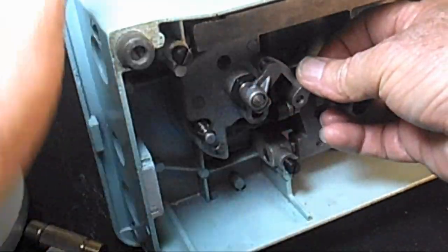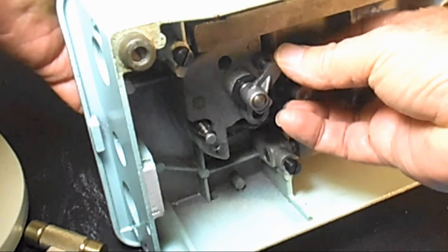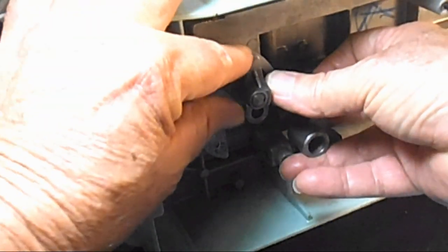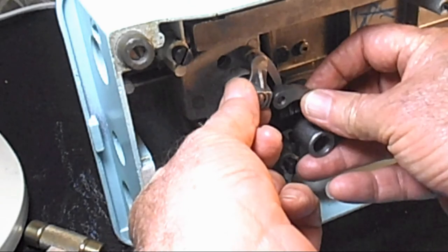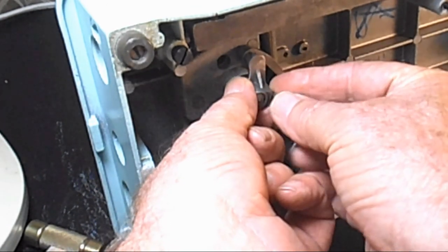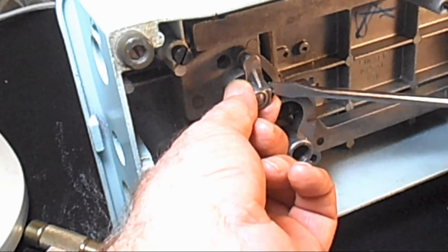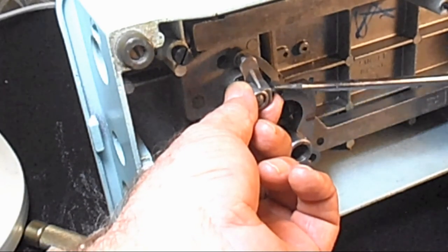And you usually have to kind of fiddle around, hold the hook so your timing mark stays where you want it, in this case about 3 o'clock, and then the set screw opening to match that area. One of those times I wish I had a third hand, right? See if I can come down there maybe, so it doesn't block the view as much. And then I'll just get my set screw started, because once it's in a few turns, you can use the screwdriver to move the bell crank around to where it lines up with that timing mark.